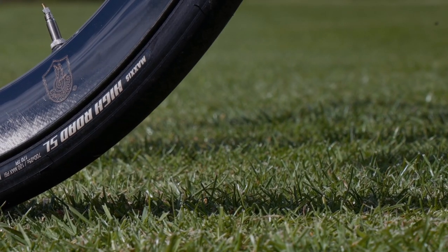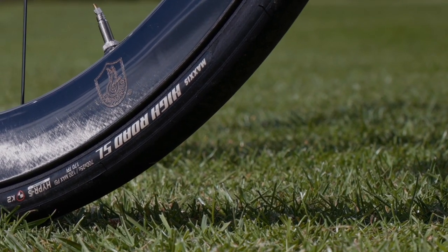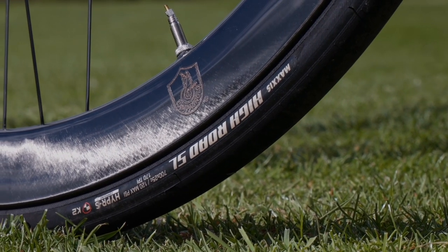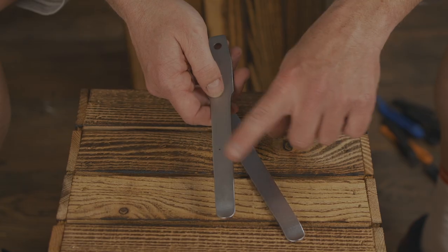Assuming that you're happy with the fit of your tyres and rims, the next thing to consider is the material of your rims. Carbon rims particularly need to be treated with a little extra care over their alloy counterparts, as deep scratches or gouges are to be avoided — carbon doesn't like those even less than alloy does. So definitely, whatever you do, don't use anything metal. Thankfully, metal tyre levers like this thing are largely a thing of the past, but even so, in extremis don't use metal.